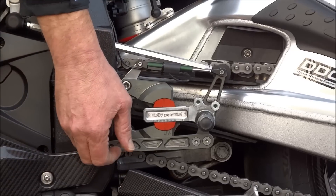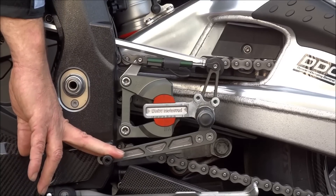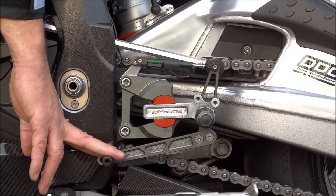Instead of using a load cell, this linear potentiometer gives 1000 readings over a 25mm travel, so as you can see it's very, very accurate — and the racing performance confirms this. We'll shortly move on to a running demonstration.